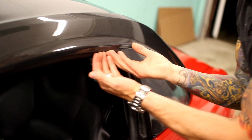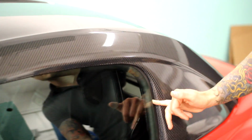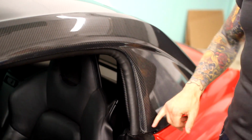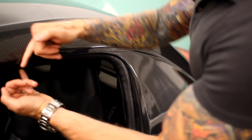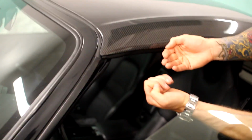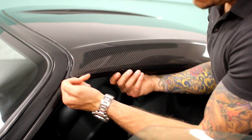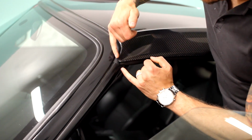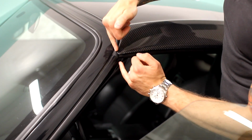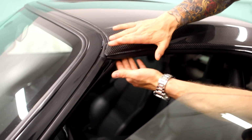You'll feel it as you come along, because when you close your door, your window's just going to press up right against here. So we had our top snug down as we were running the seal, slowly peeling the tape off. When we got to about here, we left this part loose, unbolted the top so we were able to lift it up, ran the seal to the end here, and cut the excess off at an angle with the forming of the top, so the aftermarket seal butts nicely against the OEM seal. Then when we lowered it back down, we just pinched it gently right in here.